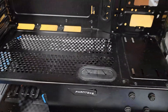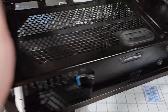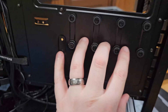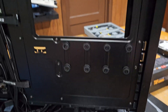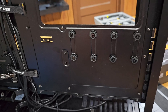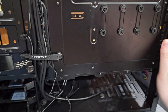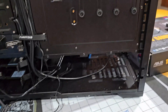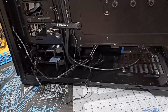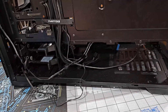The three SSDs — I haven't decided what I'm going to do with yet. Phanteks gives you mounting points here and two more on the back, but I don't have the cages to put the drives in. Since SSDs don't have any moving parts you can kind of just stash them wherever. I'm thinking I'm going to put them up in the radiator bracket if I can make the cords work, but I'm not married to that idea. I'm just going to build it and see how it fits, because with this many drives I'm going to be severely limited on SATA power cables. So we'll let the SATA power cable situation dictate where the SSDs go.